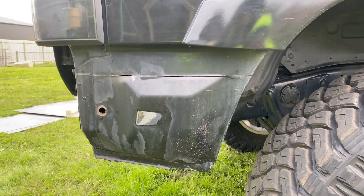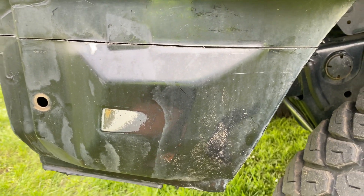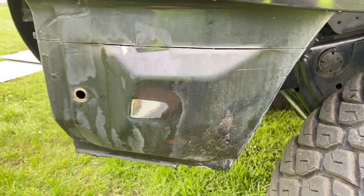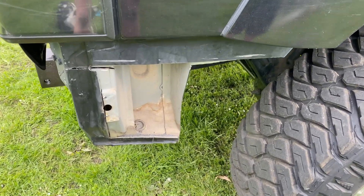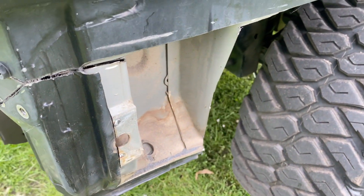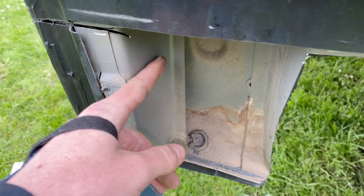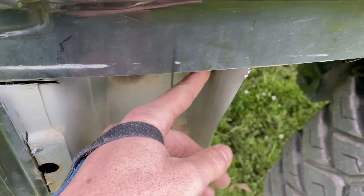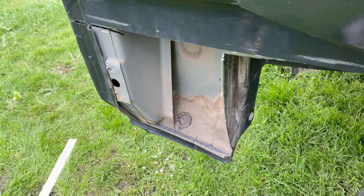I've just finished that first cut. Because there are a couple of skins in behind there, you'll probably have to do a little bit of cutting and pulling away. I'll do a little cut here and try to pull this whole piece back so I can do the cut on the inside skin. I've just pulled away a couple of those outside skins. It's a bit awkward to get into these bits — you'll have to try to match that angle as good as you can so when you do the plating it all matches up.